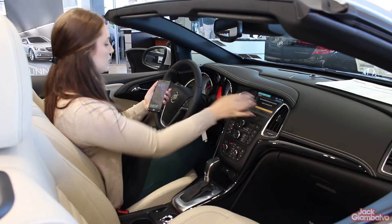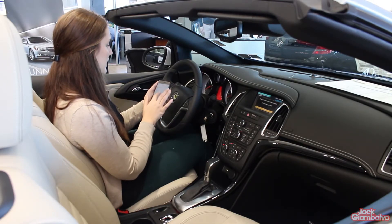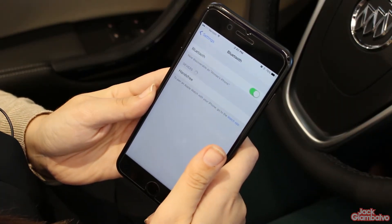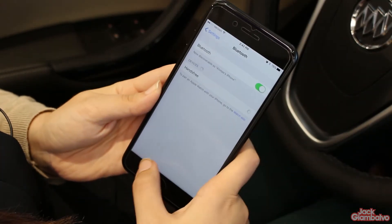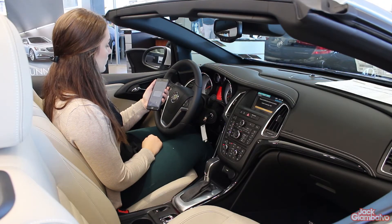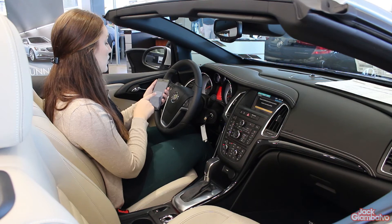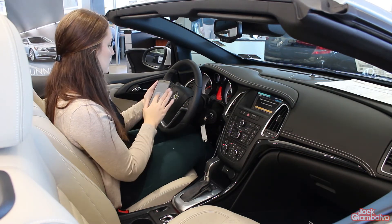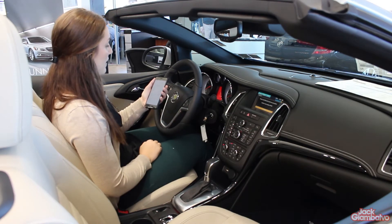The car will prompt you to start a Bluetooth search on your phone. Go ahead and open up settings again to your Bluetooth section, and you should see it pop up in my devices — right here it pops up as "Hands Free." Click on that one. It says Bluetooth pairing request: "Hands Free would like to pair your iPhone." Confirm the code with the hands free — that is the same code that we see there. Go ahead and hit pair.